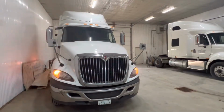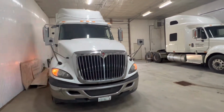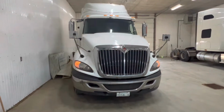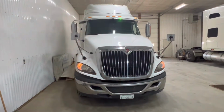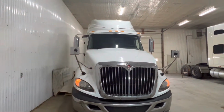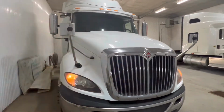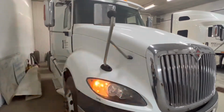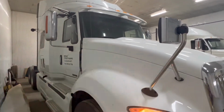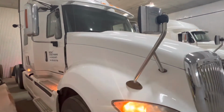As we walk up to the front of the vehicle, we're looking for any physical damage to the front of the truck. We're also going to be checking the truck in sections to make it easy to do our pre-trip, dividing it basically from the middle of the vehicle coming up. We're going to be looking at the cowling up at the top to make sure there's no damage up there, nothing's hanging off the vehicle, and everything looks in good condition. Coming down the side of the vehicle, you're also going to check to make sure there's nothing hanging off or no physical damage to the top or bottom of the cowling, and that all the general condition looks good before we lift the hood.